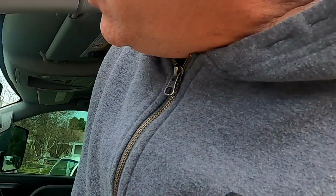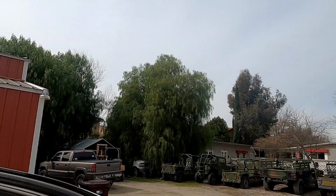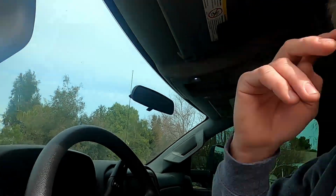Okay, a couple other things that I did in the video. I didn't really have them wrong, I just didn't know, because I hadn't driven it enough when I did that original video. I put down that the glow plugs didn't come on. I've got that 2006 GMC over there with a Duramax LBZ. On any day, the glow plugs come on for a few seconds. On a cold day, they come on for 10 seconds. All modern diesels will do that. They'll show you on the dash that the glow plugs are on.